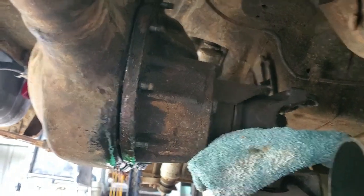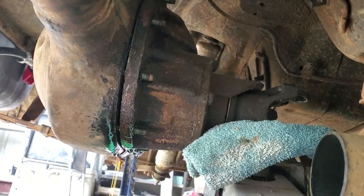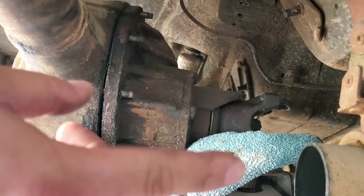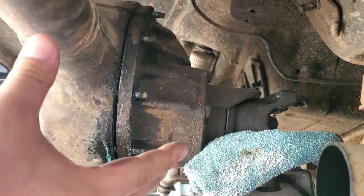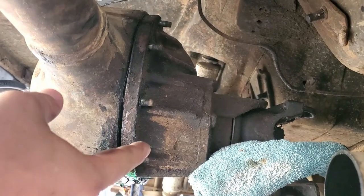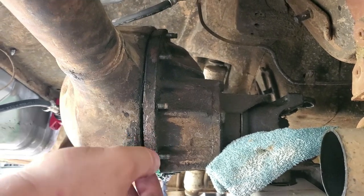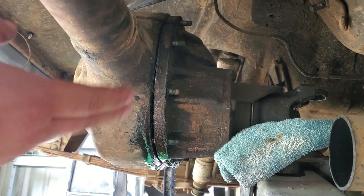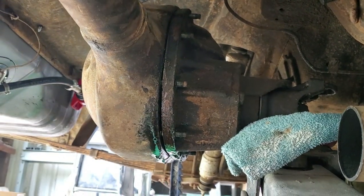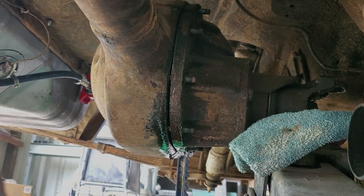Now it's split open and we can remove some tension off the jack. The oil is now draining out. From here on, be very careful — that thing weighs a lot. Once you get your jack out, support the carrier with two hands and do not have your face right under it as you take it off — you can seriously get hurt. Well, I hope this information was useful; if it was, please hit that like button and subscribe to my channel. Thank you all for watching, until next time.